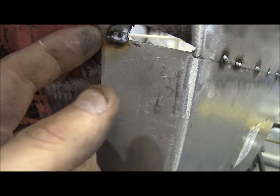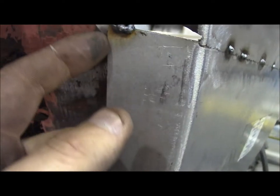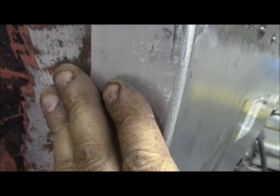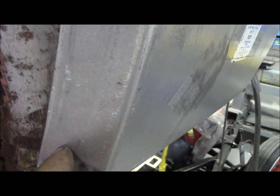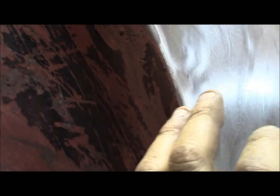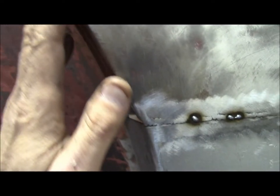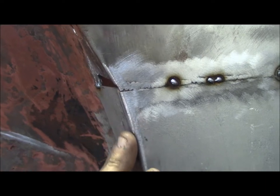Not a big deal. As you can see, I just put a spot weld to kind of hold this in place — this I got to cut now because at the moment it's overlapping. So I'm going to cut this off and then this will go in perfectly. I took my measurement from this hole to where there's going to be another hole down in here — I got to drill it out and put a nut in behind it, because that's for the fenders to go on. I will line the fenders up with the existing holes that are here and double check that the measurement is in the right spot. It all lined up nicely — this is a factory body line and it's lining up very nice.